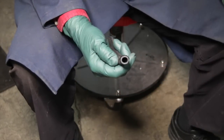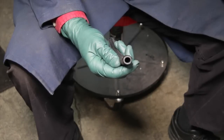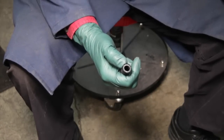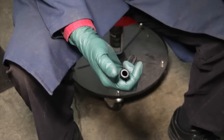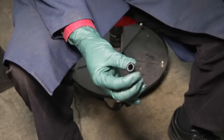I first want to show you the diameter of the outlet hoses on these old mechanical fuel-injected Mercedes. It's rather large — a little bit over 3/8 of an inch — so it's very hard to find any type of filter with a large nipple that you can clamp onto this outlet hose.